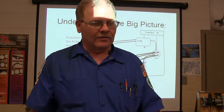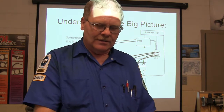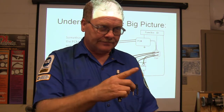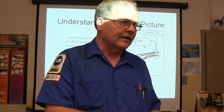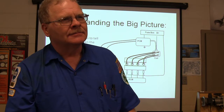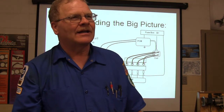I take the engine cover off, put the fuel pressure gauge on it, just like you saw me do there, and pull the fuel pressure regulator vacuum line off. You snap the throttle, it should hold that pressure. If the pressure drops, you start with a fuel filter and you wind up with a pump, typically. Well, you got 80 gallons of gas in that thing. See what I'm saying? So I had to deal with that too.